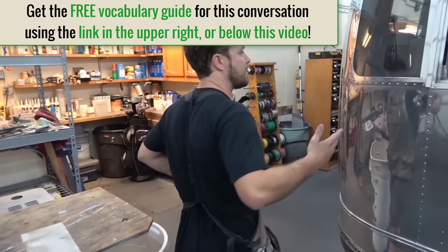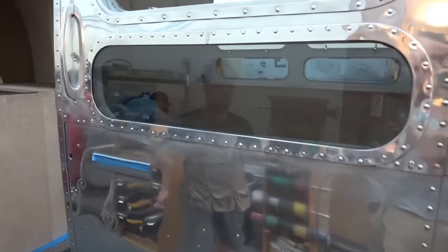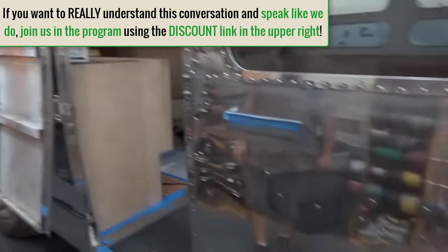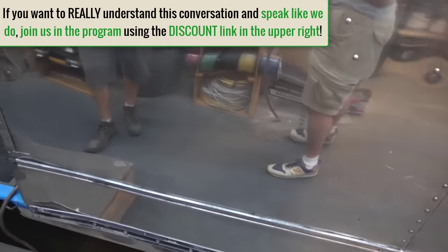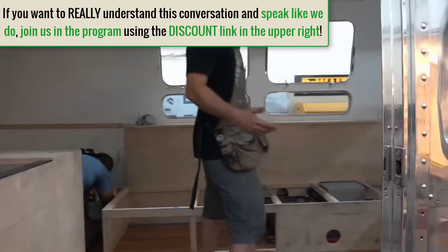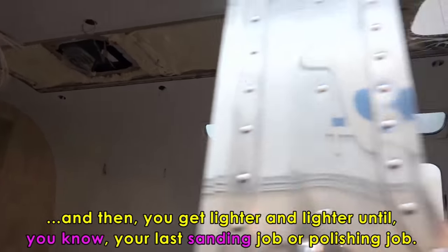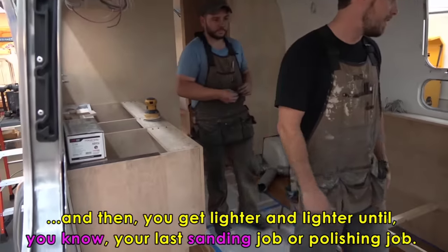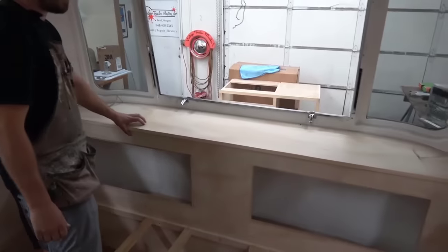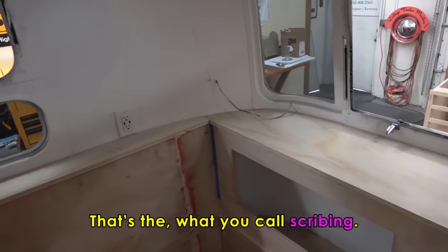This Airstream we got about 13 months ago. We've redone a lot of the windows — any window you see installed, we completely removed, cleaned it, and put it back together. You can see it's obviously getting polished and getting nice and shiny. This is probably our seventh or eighth time polishing the entire trailer. It takes a lot of time. It's kind of like sandpaper on wood — you've got to start aggressive and then get lighter and lighter until your last polishing job is just really light. These are the cabinets, you can see they're still getting built. Here you can see the kind of curvature you have to get when trying to be as exact as possible. These corners — that's what we call scribing.